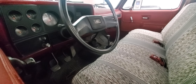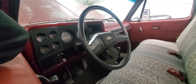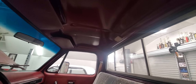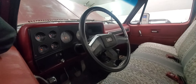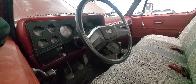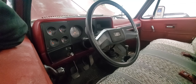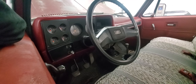The lower light under the dash wasn't coming on. I thought maybe the plug was for a glove box light, which there's no mount or provision for, so maybe I wasn't seeing it right. Started tracing it out, got it figured out so the cab light came on when I opened the door but not the one under the dash, and vice versa with the knob. I traced the white wire back and wondered if it just needed to be connected to the under-dash light and wired to battery, because I had battery power on both leads of that light. Pull out the bulb and I have power on one side — telling me these lights get power all the time, which is normal for these older vehicles.